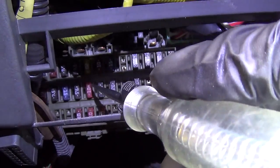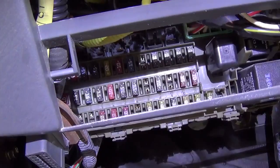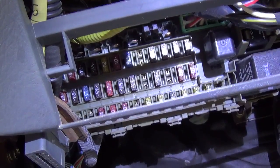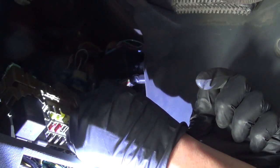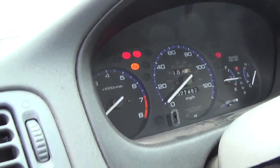Power, no power - that is a problem. Let's pop that 10 amp out and try a new fuse. If it blows again we're gonna have to find that short to ground. Fuse 15 is actually a 7.5 amp - we're replacing it with the correct amperage.